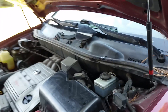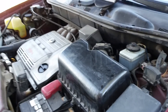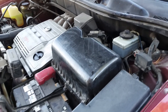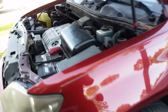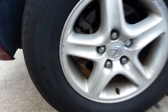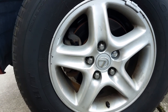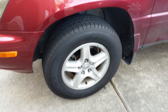I test drove it. Before I turned it on I pressed the brakes and yes, it went all the way down, then I pressed it again and it regained the pressure. Then I test drove it and it tested real good. So that's how you change or replace the front brake pads on a Lexus RX 300. Thank you, see you next time, bye.